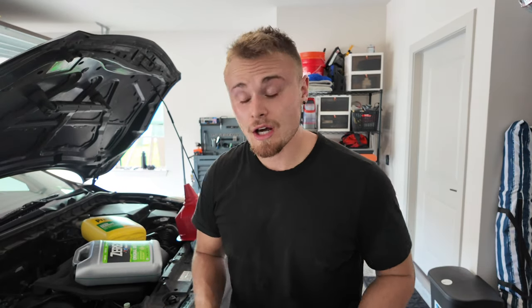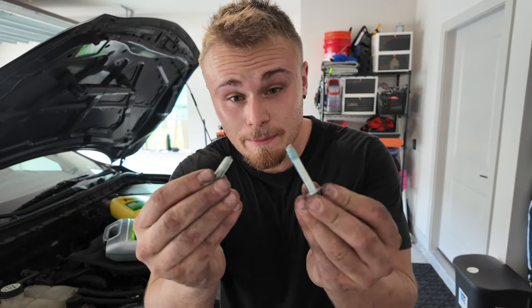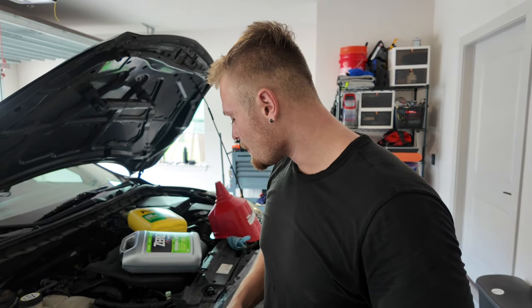If you're wondering why I have a new shirt on — one of those coolant hoses dumped coolant all over me. Also regarding the belt tensioner: just tighten it hand tight, get it a little snug, don't over-tighten or try to torque it because torquing to 14 foot-pounds snapped my bolt. Maybe I had the wrong torque spec, but just do hand tight to avoid that. It was a pain getting that broken bolt back out — just be prepared and don't drive it until it's replaced.